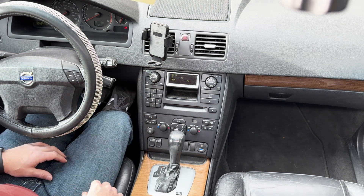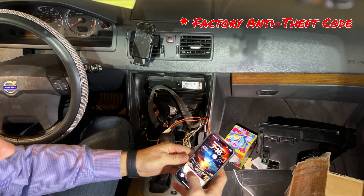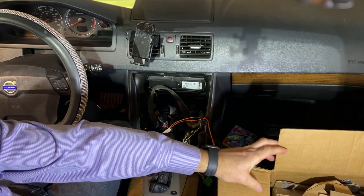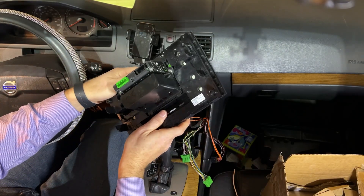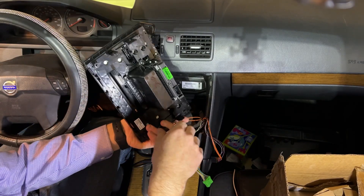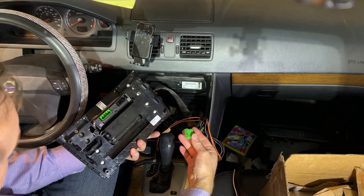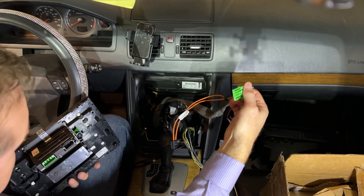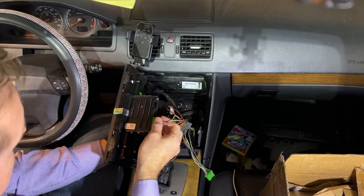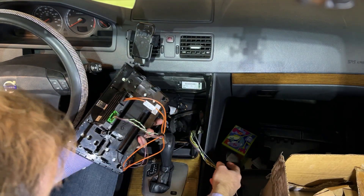So obviously that didn't work as I hoped, and I had to resort to getting one on eBay to see if I get lucky. I'm pretty sure it's going to tell me I need the code, and I'm not sure how to resolve that because Volvo said I needed the original VIN number and this is a used part. I'm hoping there's some way to get around that using VIDA or a code reader, or maybe I can take it to the dealer. Here I made a critical error by not connecting the second cable, which goes to the CD player and climate control — I thought it probably wasn't needed for a quick test, but it actually sent me down a rabbit hole.